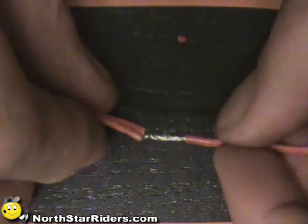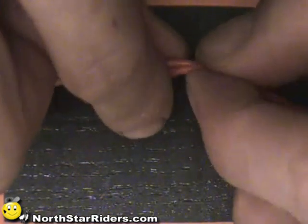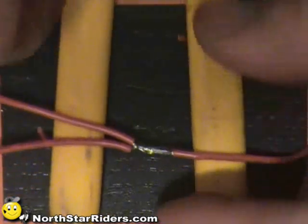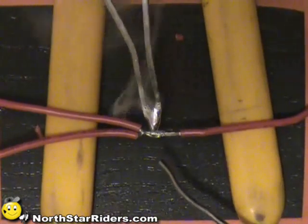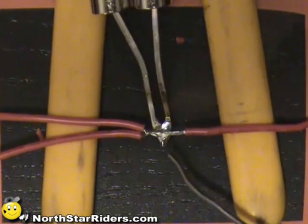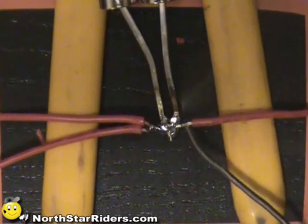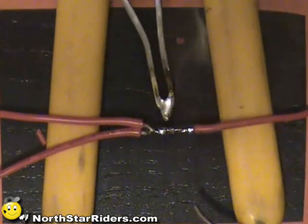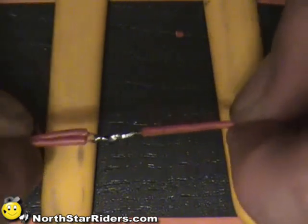You can also see that you can manipulate how this wire is going to be bent. If you want a perfect T, normally people will want to run it in line like so. The next step again is to solder — wick the tip a little bit. You can see it actually melt right on the wire. That is a good solder joint, and that is how you T one wire into another wire.